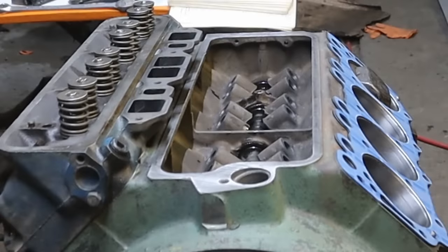I want to take them up to torque very gradually, because those gaskets are so pillowy that you could warp the thing. Yep, very, very carefully. Two or three rounds at least.